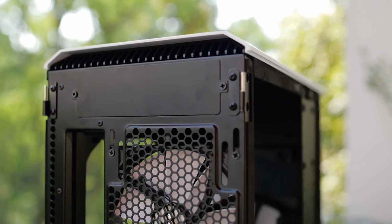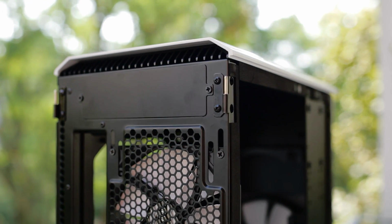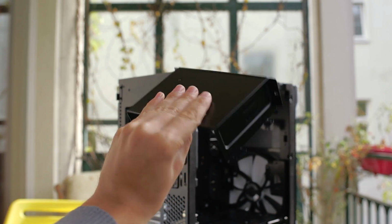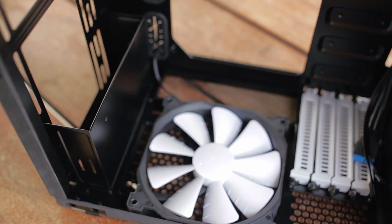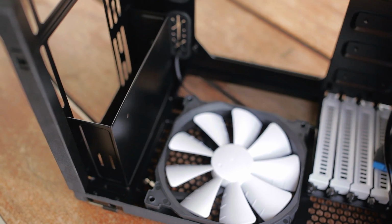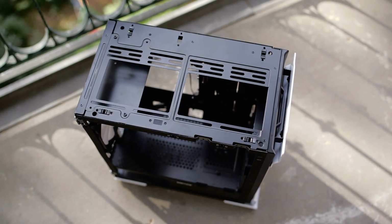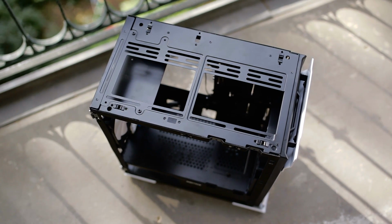So from an aesthetic standpoint it makes sense, but accessing your optical drive will be a complete hassle. There is a bracket for installation that doesn't block any rubber grommets, so don't expect any wiring interruptions, but it will limit top fan placement, so you'll only be able to utilize front half portion of top mount. It's still though an innovative spot, and I'm liking Phanteks thinking outside of the box.